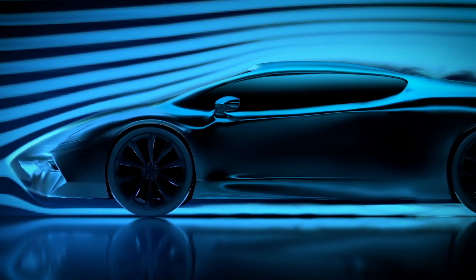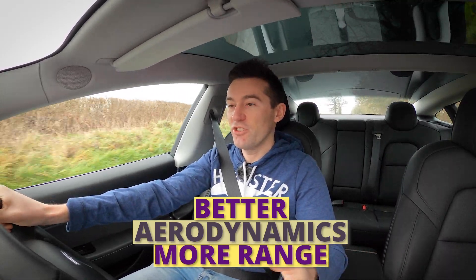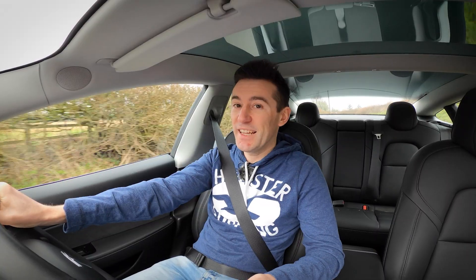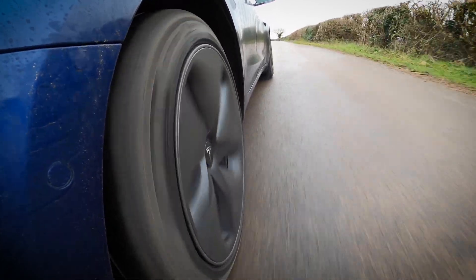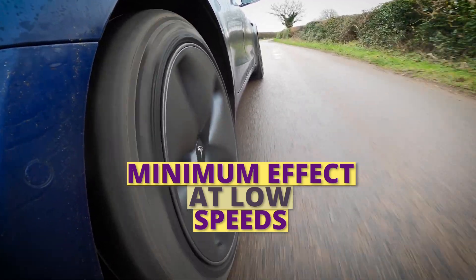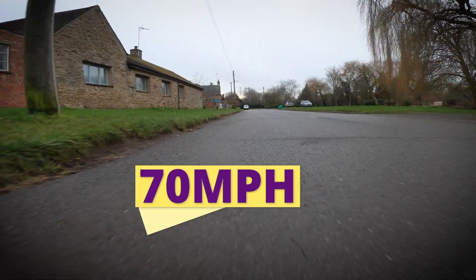Aerodynamics aim to make something push through the air easier — i.e., reduce the force it takes. Less force means less energy, which means more battery, which means greater range. But air resistance isn't constant; the faster we go, the greater the air resistance is. This is why your watt-hours per mile rapidly increases when you're cruising on a motorway in your Model 3. More speed equals more wind resistance, more energy, less range. So if the majority of your time is spent driving around town at low speeds, there's not going to be much air resistance, which means your aero wheels aren't really going to be doing anything — because reducing 10% of nothing is still nothing. So this 10% figure bandied around by the Tesla VP probably hasn't applied to the majority of journeys I've actually done.